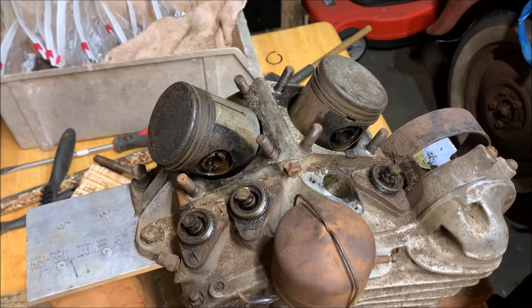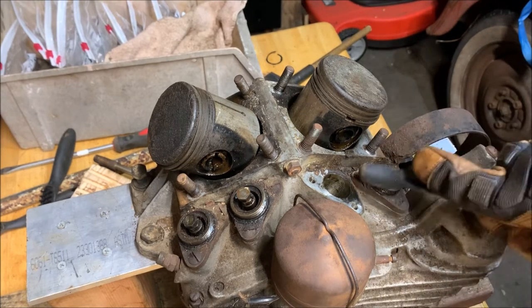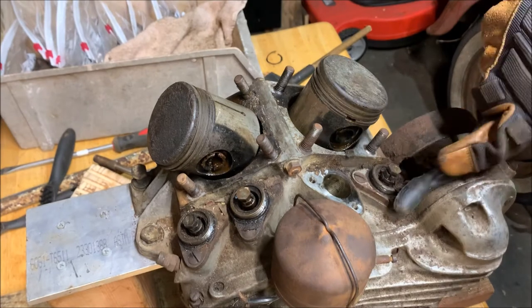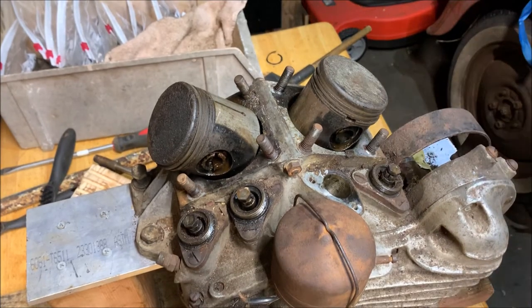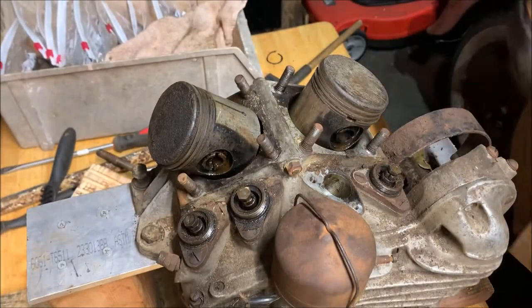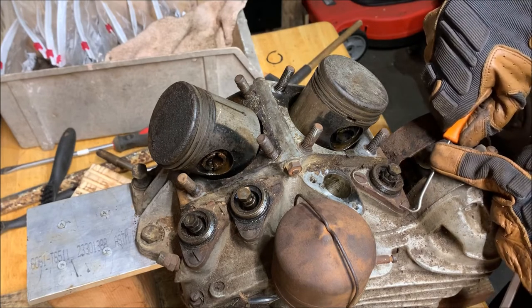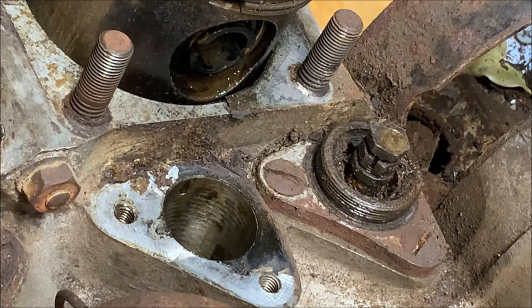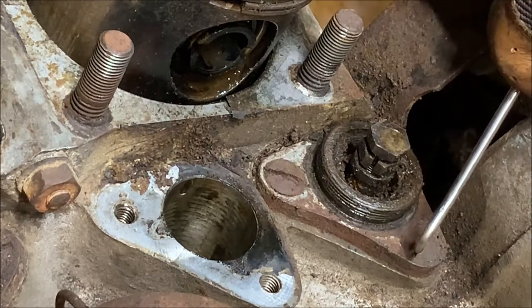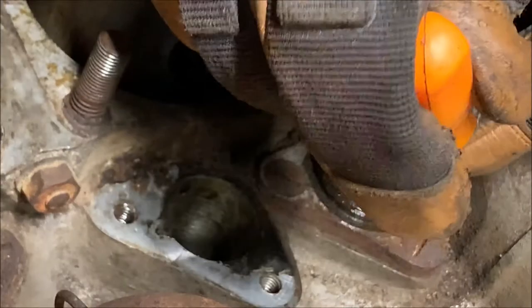All right. Let's get a small brush, synthetic. Okay. First thing I'll do is remove these screws. So I'm going to take my pick in here and actually pick out material. You can see that just came out. Let me zoom in closer actually. So you can see in those screw slots, as I take my pick in there, I'm actually removing material. And this is good because that means now my actual screwdriver will be able to sit farther down in there and fully engage.